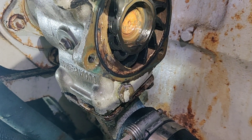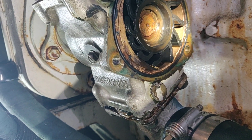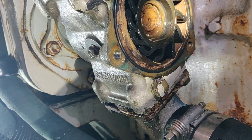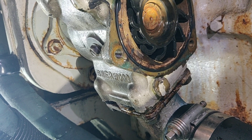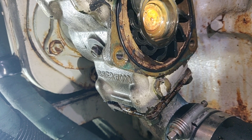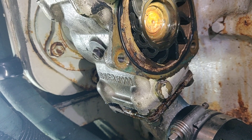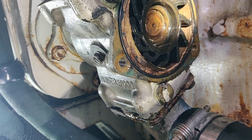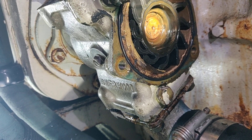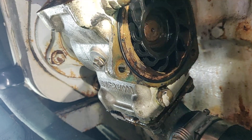That's coincidentally how I adjust the valves anyway, by rotating the engine — you just turn the alternator and it turns the whole engine. So that breaks the seal of the vanes on the housing. Another reason I wanted to show you that is one of the hardest things to do is get the key back in once you get the new impeller in — you've got to line up the key. What I was doing before was rotating the impeller, and that was a pain in the ass. The easiest way is, once you get that new one in, rotate the engine again — it turns that center shaft and you can just line up the key with the keyway and it slides right in. Way much easier. That's a little tip that hopefully may help you.